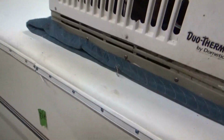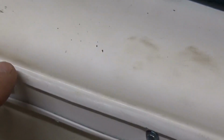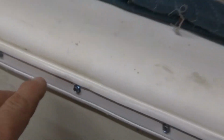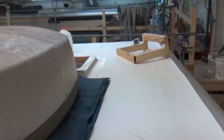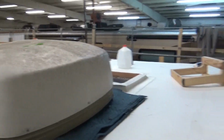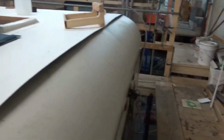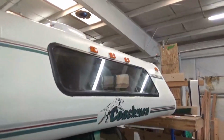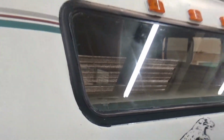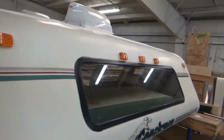Again, first strike right here. That right there, see that jaundice color? That's a special primer we use, and it helps pull the caulking in. Got a crack cover. We're going to try and see if we can stitch that back together. But otherwise, we're about ready to roll. Coachman, we are done. Got the bunk rebuilt. One of the other things that cause a lot of issues is that little gasket that goes in there. They call it a glazing. It's a rubber glazing. We take it out, and that's fully loaded with urethane.